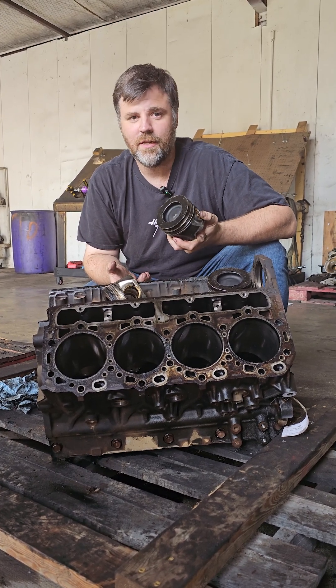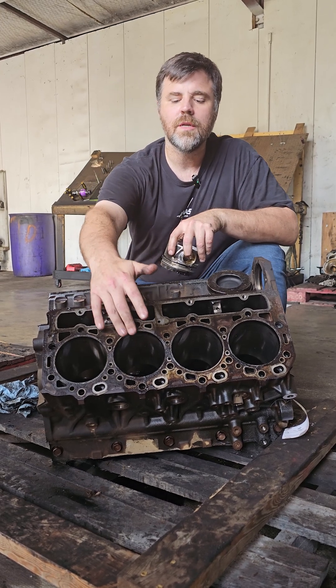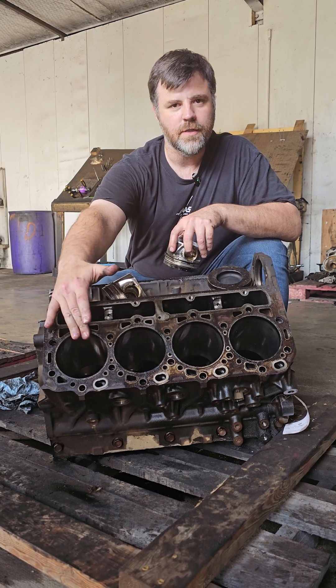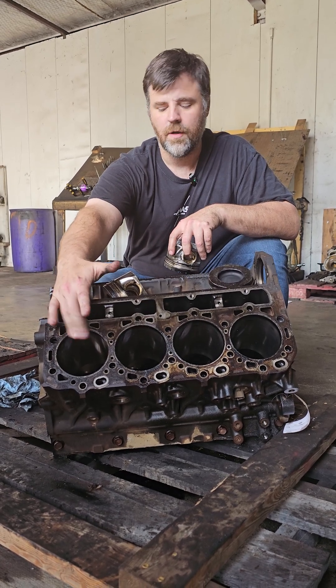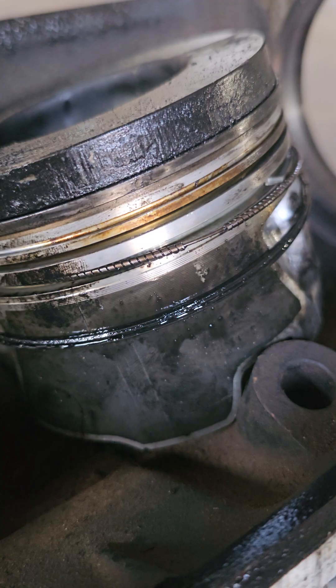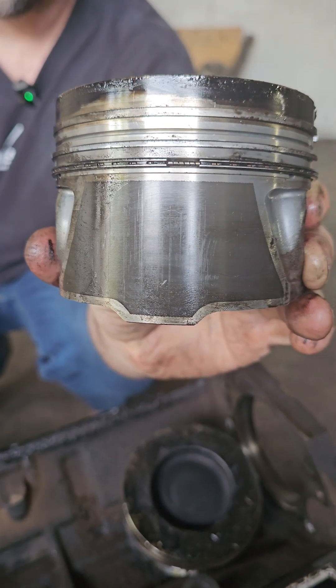I initially thought that this was a cracked piston. In the last video, I suspected a hole, but the actual hole causing the blow-by that we were seeing is this hole next to it. There's some major scoring in that cylinder, and what causes major scoring of the cylinder is obviously an overheating condition. Now when we start looking at these pistons, there's light scuffing — it's not excessive or horrible on this one, but on the skirt you'll notice there is some scuffing going on.